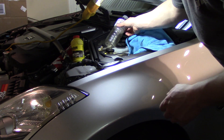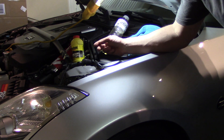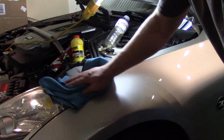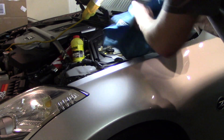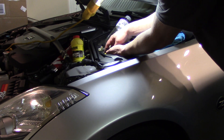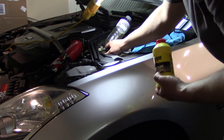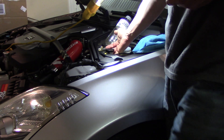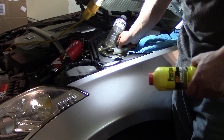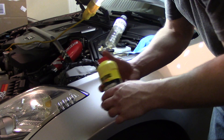I've even read you can mix DOT 3 and DOT 4 - you could pull out a little DOT 3 and put some DOT 4 in and do this process a few times until the majority is DOT 4. If you're wondering why brake fluid is used for the clutch, it's just hydraulic fluid. Your clutch uses the same exact fluid as your brakes - it's hydraulic pressure. So DOT 3 going into your brakes master cylinder is the same going into your clutch master cylinder.